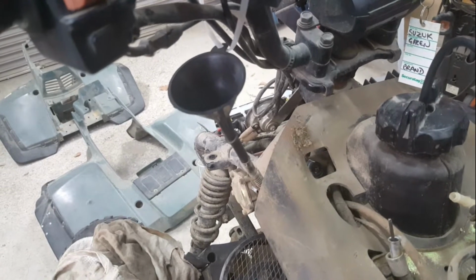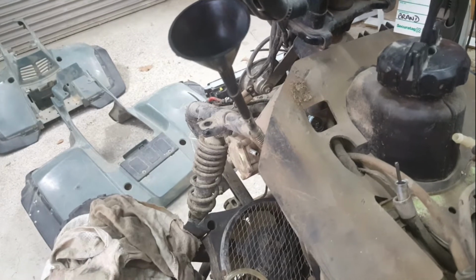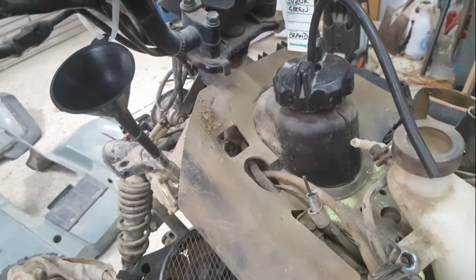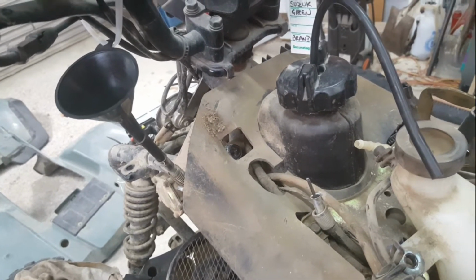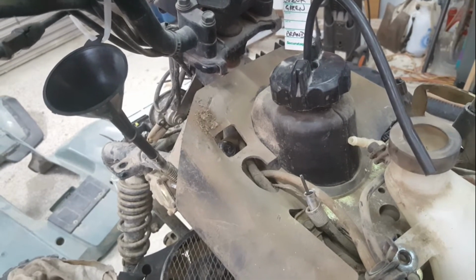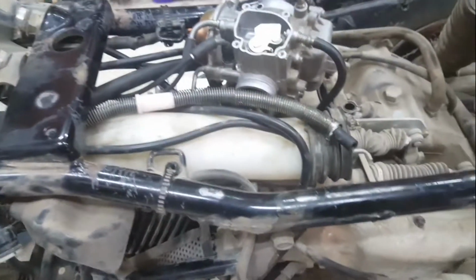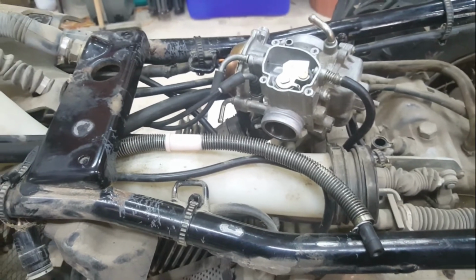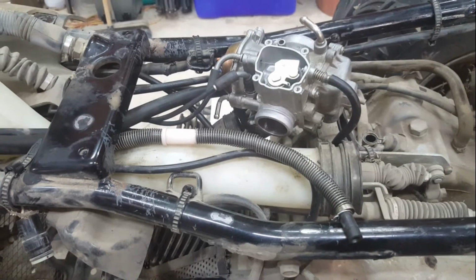Just swinging around. That's my gravity feed fuel line, just hooked up to the line that came from the petrol pump. I don't know what the fuel in the tank's like. I think I'll drain that and clear the system out before I try and fire fuel down this system. I ran a bit of fuel in there and drained it here just to check that line is clear, and we'll continue on. I'll now attach them with the flexible hoses to this